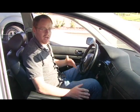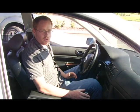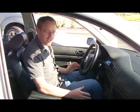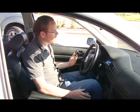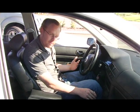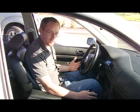So there's something you've got to balance when you're driving a manual transmission. When you shift, you always have to have your clutch pedal pushed down and engaged to disengage engine power. You want to take away the engine power from the transmission, then select a gear. In this case, we're going to want to get going, so we're going to put the vehicle in first gear.